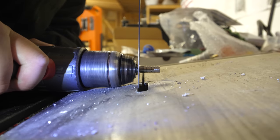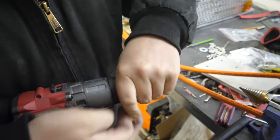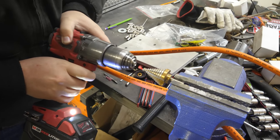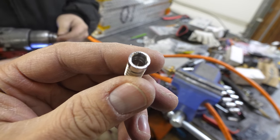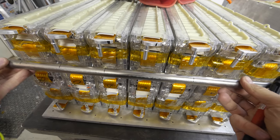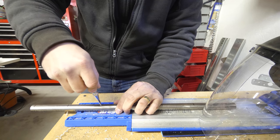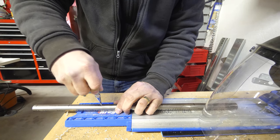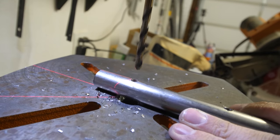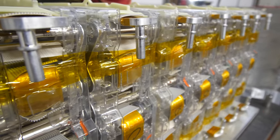Don't do this at home, but it does get the job done. We take those split nipples over to a vise where we've clamped down a step drill bit, and spin the cut nipple inside to deburr it — getting rid of the sharp metal flanges. The 3/4-inch metal tubing that the liquid flows through is taken to the drill press where we've punched out holes to weld the nipples onto, allowing liquid to flow through all 18 battery modules.